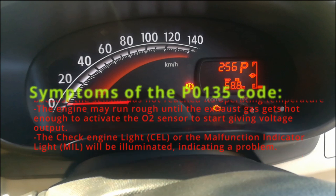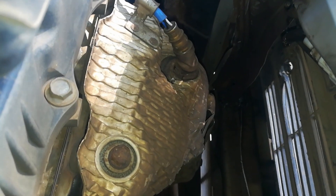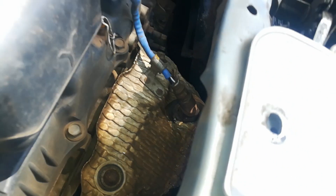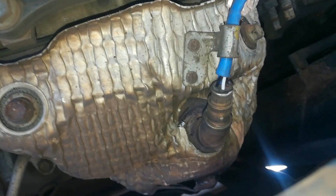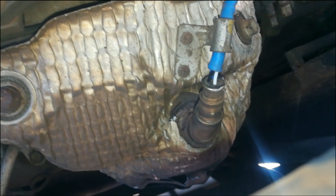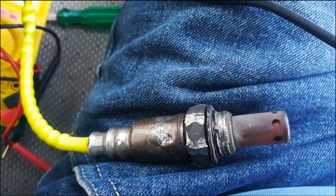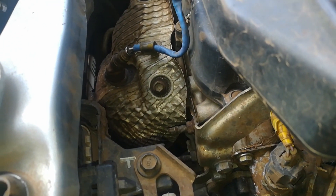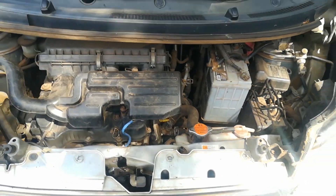Now let's look at what is happening with the O2 sensor. It is the first sensor after the exhaust manifold, and on first look I can see it is bent — something has bent it. A good O2 sensor is usually straight, as you've seen in previous pictures. This one looks bent from all angles. Comparing it with a good one, the good one is straight. But this one seems bent because something hit it from one side, bending it backwards.